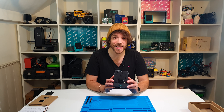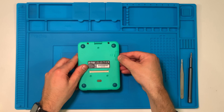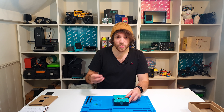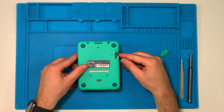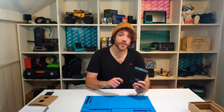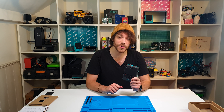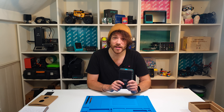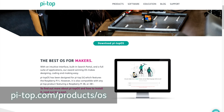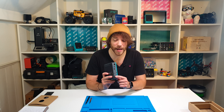Once the Raspberry Pi is installed, the Pi Top is ready to go. The last thing you need is an operating system. Flip the Pi Top over — there's an SD card slot that opens to access the Raspberry Pi's SD card slot. Burn an operating system onto an SD card, pop it in, and put the lid back on. We recommend Pi Top OS, our own version of Raspberry Pi OS — it's packed full of features, works really nicely with the Pi Top, and talks to the internal microcontroller to get the most out of all the Pi Top's features. You can use your own OS too — things like RetroPie work great as well. The download link for Pi Top OS is in the description below.